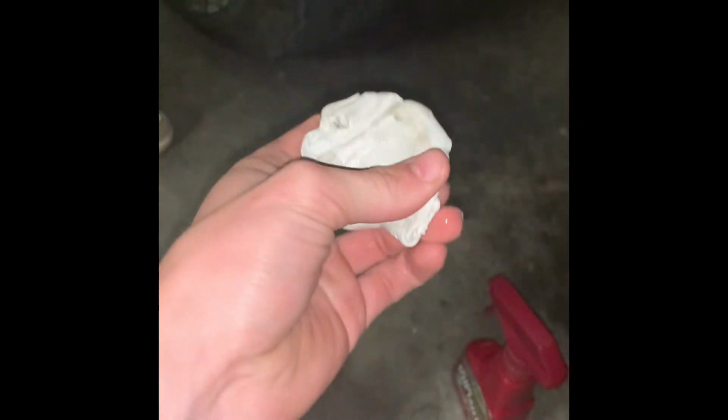Alright, so you can still see there's a little bit of residue after you get done with it, so clean it all off with the quick detailer again. And then get your clay bar out and put it into about 4 fingers wide. Wet your paint. And then just glide it. Don't put any pressure down. Just glide it across your paint like this and it'll slowly get everything out of it, as you can see right there. And when you go to your next door, make sure you pull the clay apart. That way you don't use the same side on it.